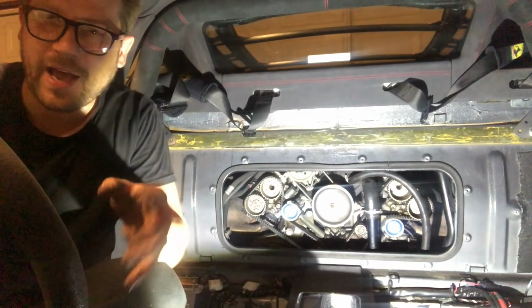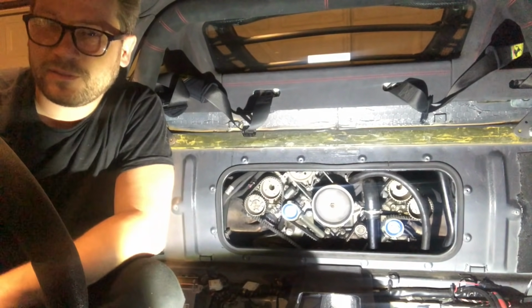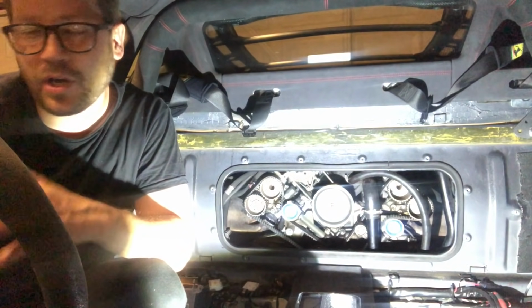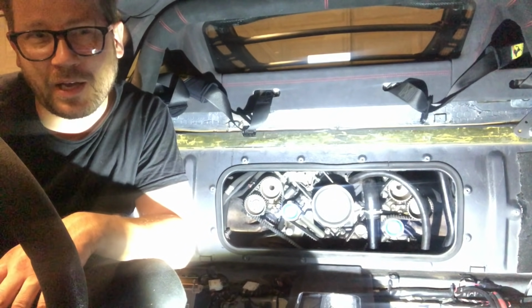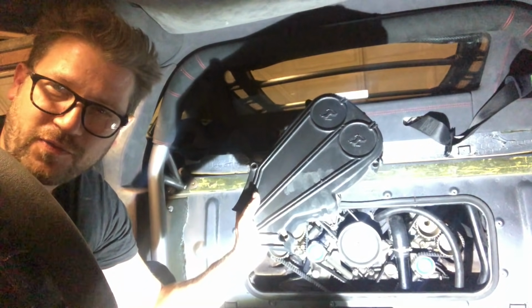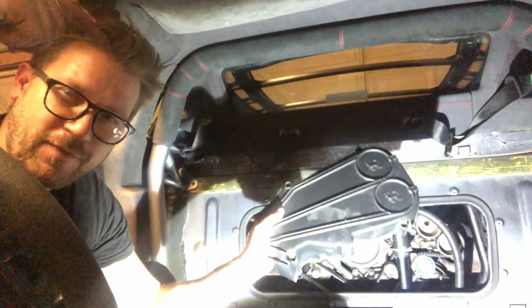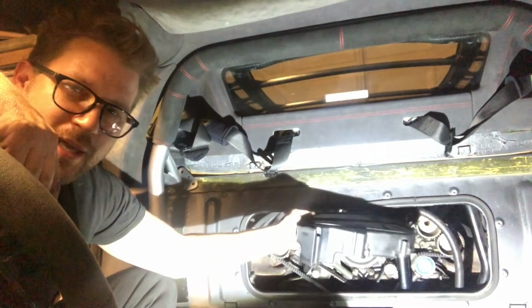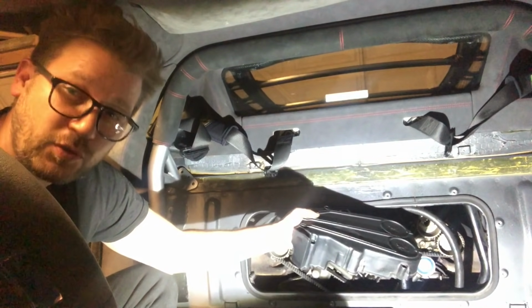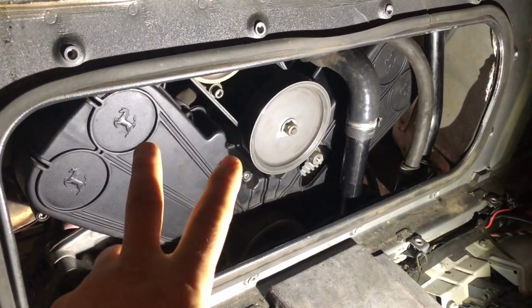So everything looks okay. I'm going to carry on, replace the covers, and then we need to go through a test cycle with the engine. Now that I'm happy, everything turns over, sounds all good. I'm going to replace the timing belt covers. So the 5mm hex screws need to be to 9.8 Newton meters. Covers are now both back in place, so just 2 more belts to go.